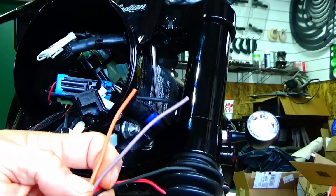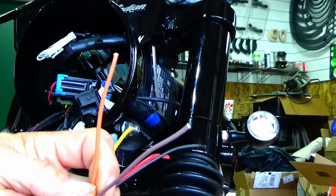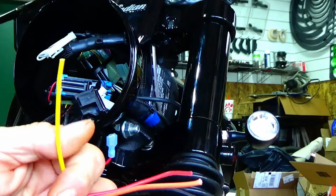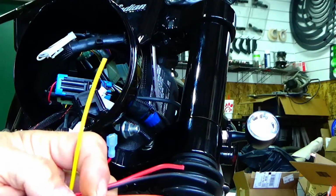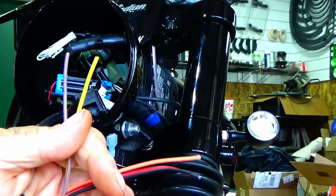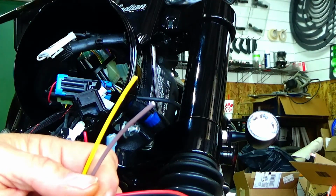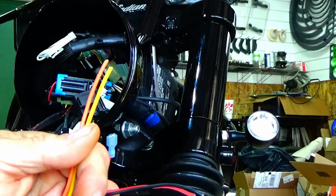And I know some people are going to be like, ugh, I have no idea what this means. It's fine. And what happens is this is connected to 30 when this thing is energized, right? And 30 is the yellow wire. I'll try to explain this to you a little better. But basically, when 87 connects to 30, there's power, okay? And then what's left is 87A, which is orange. This is normally closed, okay? And this connects to 30 when there's no power to it, okay?